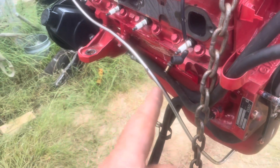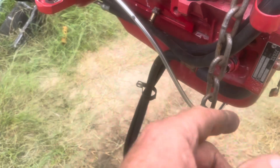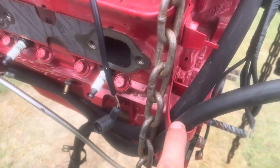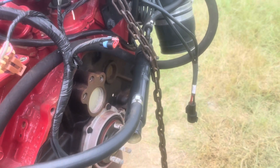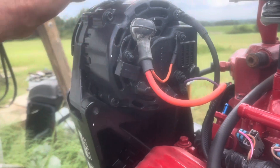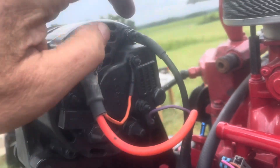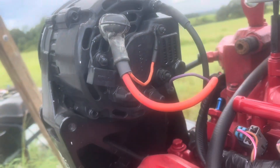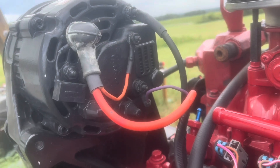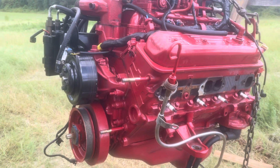I'm going to leave the power steering hoses attached to the pump — they ran down and their bracket was on the oil line, but they kind of held the power steering up. There's a bracket back here for the power steering on the back corner. Here's a quick view of the alternator connections: orange to here, purple to there, brown to black to there, and main output wire from here. I'll take them loose and then take the alternator and power steering off as a unit. The power steering and alternator have now been moved as a unit.